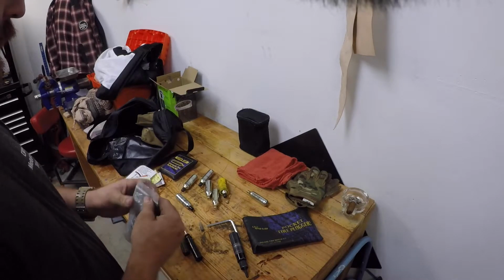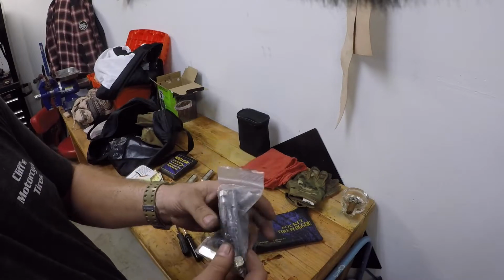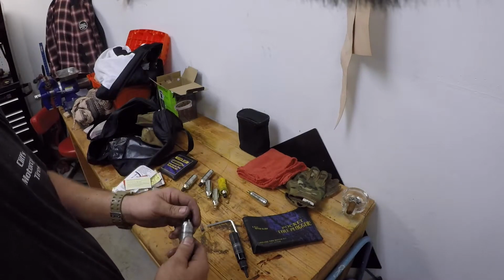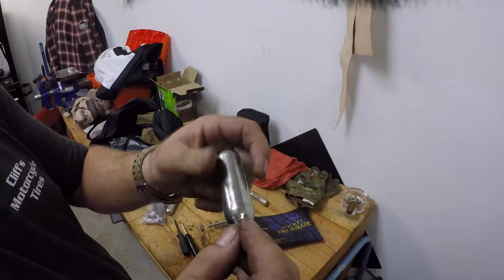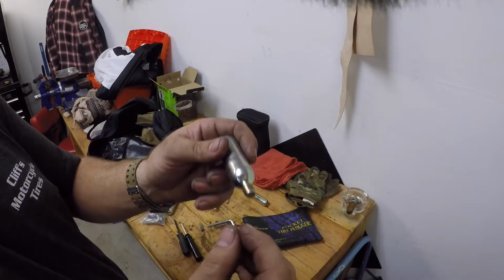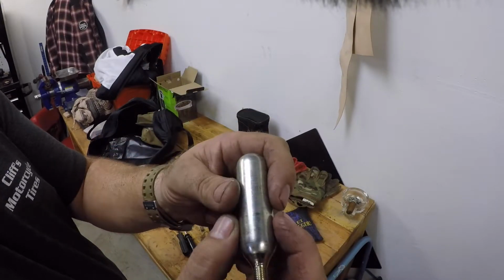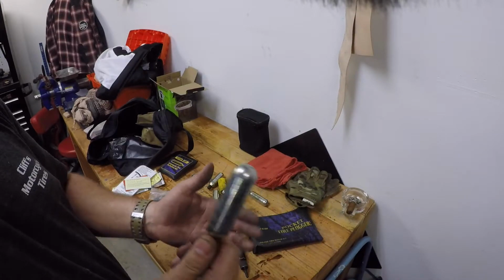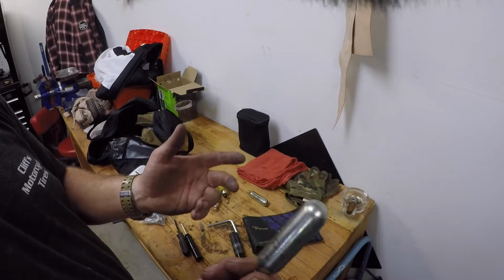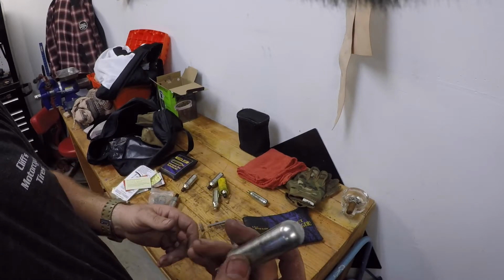And then this kit came with, oh, there's a little extension hose. These are the threaded CO2 cartridges. You thread this in there after threading that onto your valve stem. Thread this in there, puncture it, release the compressed air into your tire. I've heard it takes about 3 or 4 to fill up a 180/65, or I got a 180/55/18. It takes about 3 or 4 of these.